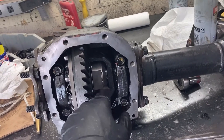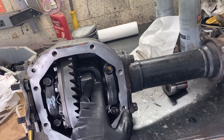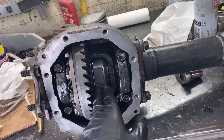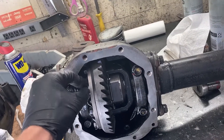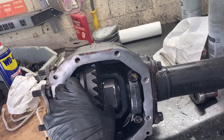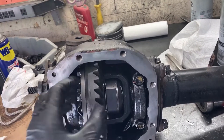I ran one in mine on 31 inch tires. I was also rear locked and it performed awesome. I did have a 4.7 transfer case, which I feel like is necessary to really see the benefits of the locker. If you had normal gears, you're going to be just having to throttle it up anyway. So the lockers probably aren't going to notice them as much as if you do have the low gears that you can really crawl and let the tires slowly grab their way into things.